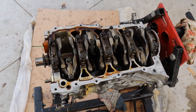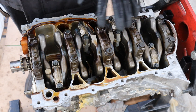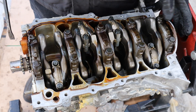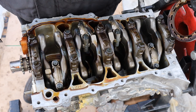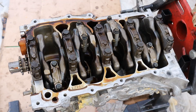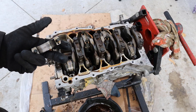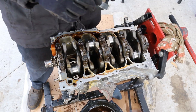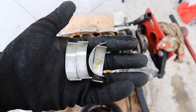Squeaky clean. This engine's so small I'm going to have to zoom in. Take a look at the bottom end of the 2ZR engine — things here are very simple. We just have five main bearings and four connecting rods for each piston. Things are pretty clean with not much tarnish — that's probably because the coolant ran through here and cleaned everything up, but also the previous owner told me he took really good care of it with oil changes. The connecting rod bearings are clean, amazing, just amazing quality — 290,000 kilometers and there's not even a proper scratch on there, not even the coating worn off. Look at how polished these crank bearing journals look.